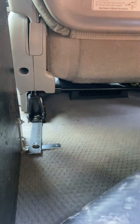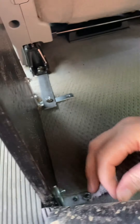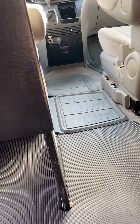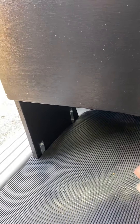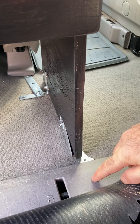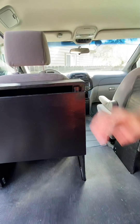On this side, the screws are self-tapped directly to the floor and then bolted into the sides. On the other side you have to watch out because that outside is the gas tank. I was able to get a bolt here because it was away from the gas tank, and over here this bracket goes underneath this plastic piece with a self-tapping screw — because this side had space where I knew I wouldn't hit the gas tank, and the other side did not.